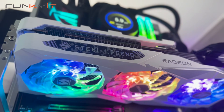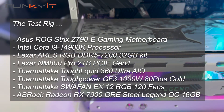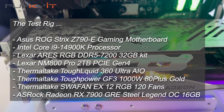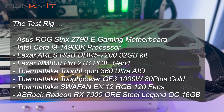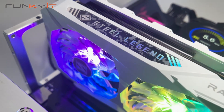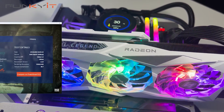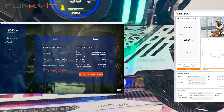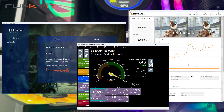During our tests, we used an Intel Core i9-14900K on the ASUS ROG Strix Z790-E Gaming Wi-Fi motherboard, along with 32 gigabytes of DDR5-7200 RAM. With all settings on auto, we got really good scores across all of our benchmarks, including a high score of 4,982 for BaseMark GPU, an AMD FSR 2 score of 69.54 frames per second, and a Passmark 10 GPU score of 35,613.